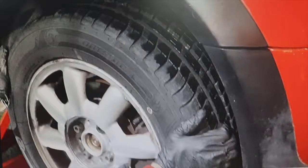Well, I'm going to make a very short video. They brought us a Mini that had steering problems, the steering wheel vibrated, and well. The owner asked us, why, when the wheels are checked, does it move from right to left and from top to bottom? Look there, you see, from right to left. This vehicle has slack, it has a problem, and then we also do the test from top to bottom. There is no slack there.